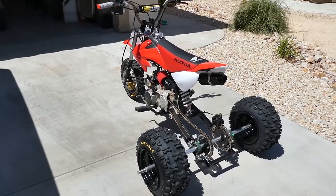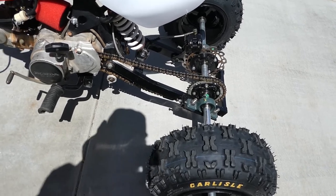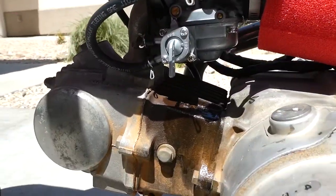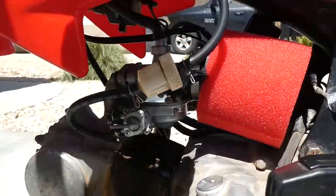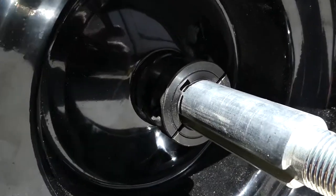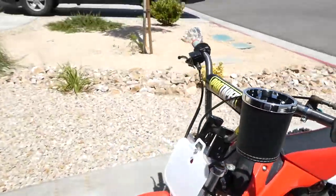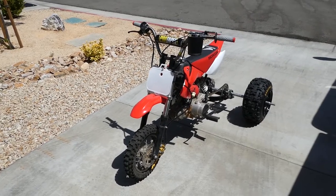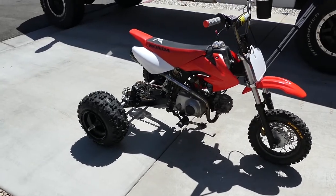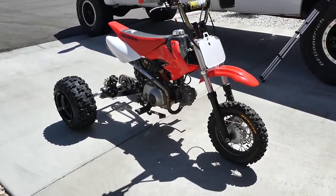All right, well there it is — smoking like crazy but it works. That sound you're probably hearing is the chain; it's a little bit too long so I got a half link for it which should take care of the slack so it won't rattle. I forgot to put the chain guide on so it was just slapping around. Also leaking a little bit of gas from the brand new carb, so I'll replace the O-ring and see what happens. I keep forgetting to mention these ends are going to get cut — I have axle collars right there to hold the wheel on, so these are just going to get cut flush and painted black. Pretty cool — it works, brakes work, power feels about the same as stock 70, I would imagine. Once I get it all dialed in I'll do a proper test ride video and take it out to the track or wherever I can get it on dirt. But until next time, thanks for watching you guys — see you later.